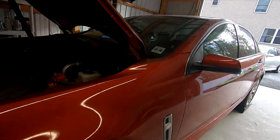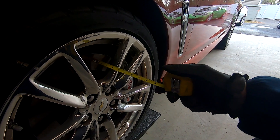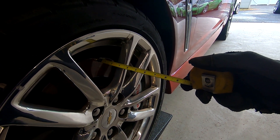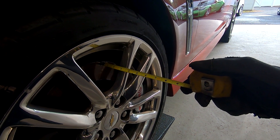For six pistons I would go with about two and three quarters, maybe even three inches of backspacing. Here's an example of a car that comes with Brembos from the factory — you can see that from the face of the rotor to the back of the spokes you have two and a half inches of clearance.